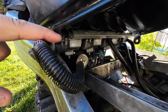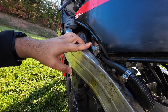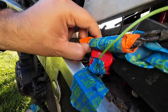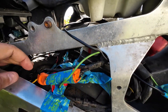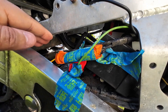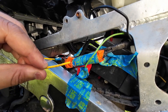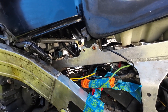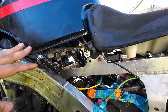So I made up a fuel pump replacement. What we do is just shut the fuel off, and to run the pump we have a Milwaukee battery with duct tape. We got the negative there, already going in, and here's the positive — this is our on/off switch. So we get the bike started, turn the fuel on, turn the pump on that way.